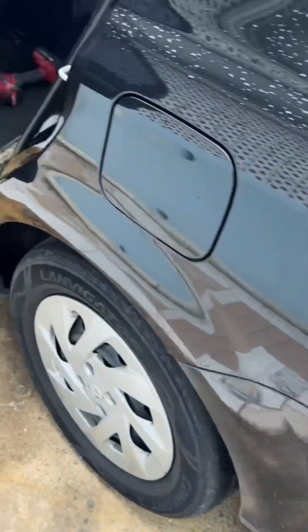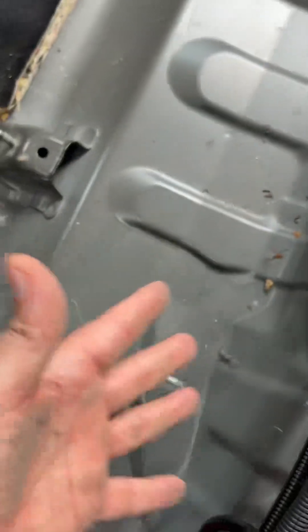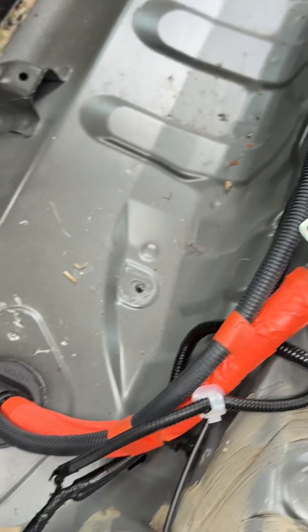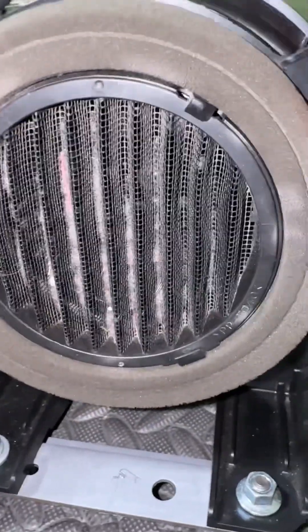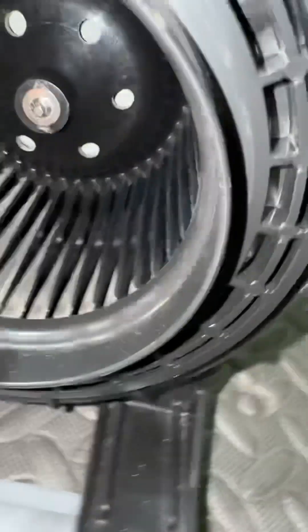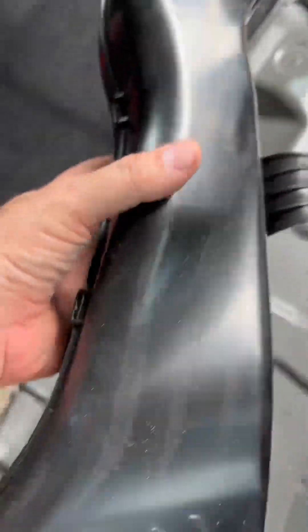Now inspecting the cabin where the battery sits, you can see all this debris — it all goes inside the high voltage battery. Clearly absolutely no service here. The cooling fan filter is not the worst but very bad, and the fan itself is pretty dirty as well. The exhaust vent also tells me a lot. Stick around for the next video where we're going to service the high voltage battery of this 2019 Toyota Corolla Hybrid.